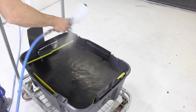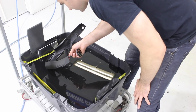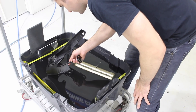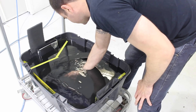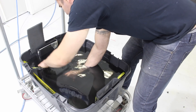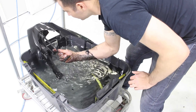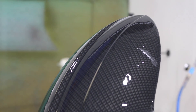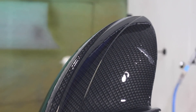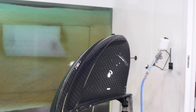Once you've got the hang of it, it can be quite fun — you can get any graphics on almost any parts. You should also be mindful of safety. Because you're getting excited, try and remember to wear gloves. Having this carbon fibre film on your arms and skin is probably not a good idea — make sure you wash it off straight away. So that's got the film still on it. I'm going to let this sit for about five to ten minutes and then put it under some running water to wash all that film off. That all needs to come off and then we can clear coat it.